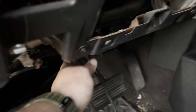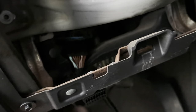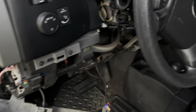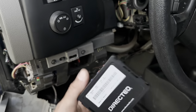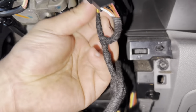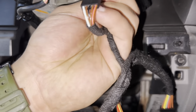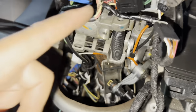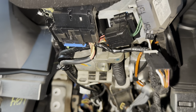So the first thing I did was connect the new OBD2 port and screw that in. Then I just tuck this pigtail up and I'm going to run this harness up through here, up to the steering column. Next, I'm going to connect the box to the harness provided so I can get it in place and zip tie it up. One wire connects on the side right here, you plug into this harness, and then the jumper piece plugs right in there. Then this one goes right here.